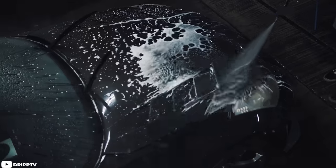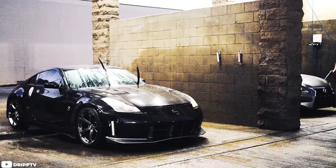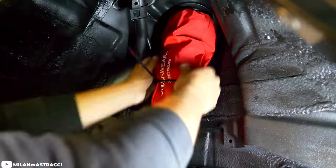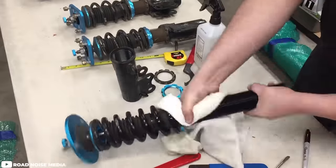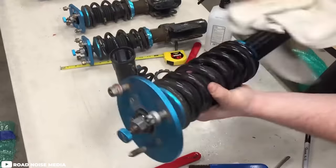Additionally, when cleaning your car, ensure that after washing you air dry your coilovers. A lot of times people will blast their coilovers with a high-pressure wash and some high-foam soap for a cool Instagram edit, but then they never actually dry it off. If you run out onto the road with salt, it can increase the buildup — water solidifies that buildup. There are coilover covers out there that prevent dirt from entering, which is a good idea, but dirt can still kick up underneath and never get washed off. If you do have sleeves, it's recommended you take them off occasionally to clean the inside as well.